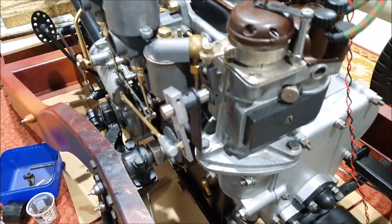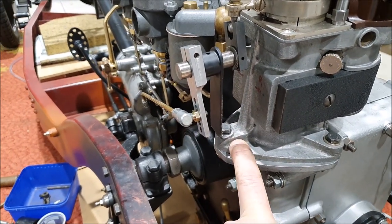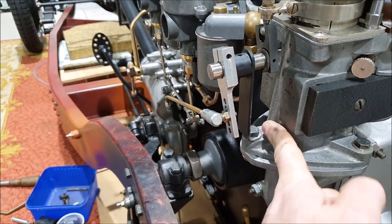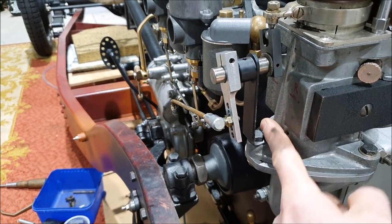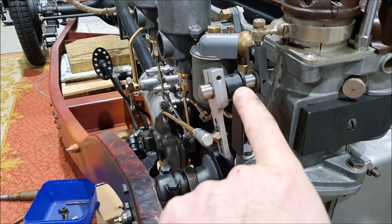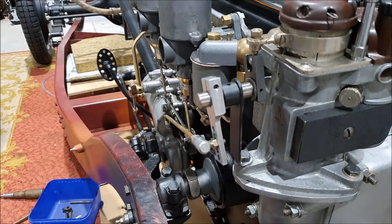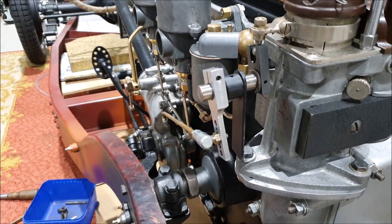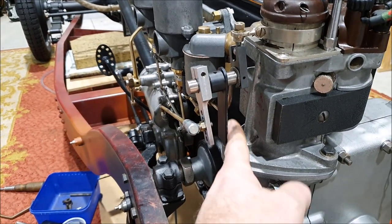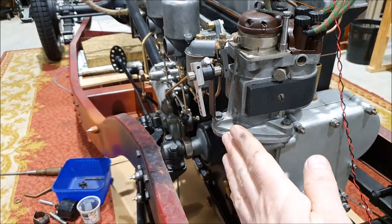I think I've got my linkages correct — I just need to move it all in closer, which just needs a new bracket. When I went back and checked pictures of other cars, the bracket there is effectively around the other way — it's in much closer. I was quite pleased with myself making up this little bracket — I actually machined up a little bush, that's all reamed out, there's a little oil drip hole in the top to keep it lubricated. But it sticks out too far. So I need to redo this bracket and move all of this in so this lever is tight in there and won't hit the line of the bonnet.